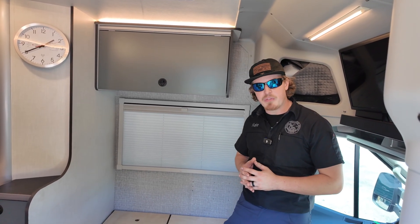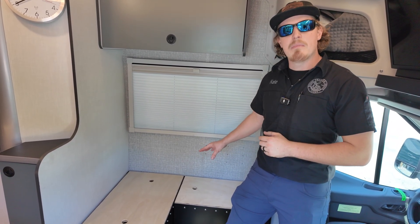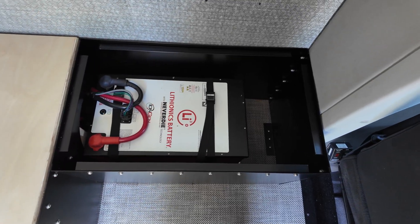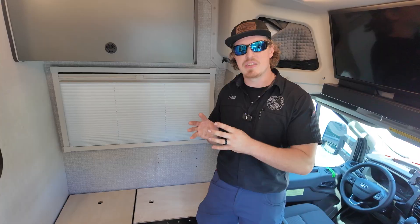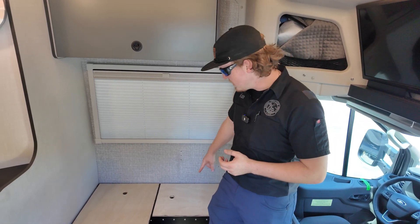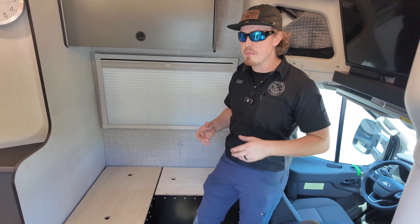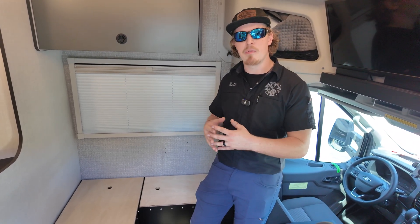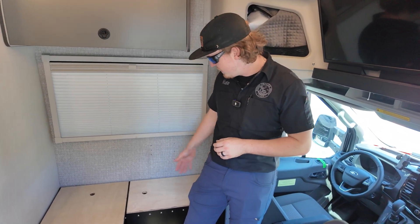In this particular case, the customer opted for a second 320 battery out front and a third battery installed on the inside — a lithium 630 amp hour battery — giving a total system capacity of around 1,200 amp hours. This is the more cost-effective solution; you're getting just about the same amount of capacity for a cheaper price. Running the single 630 is compatible even though we're running two 320s on the outside, and it has a slightly smaller profile than two 320s side by side, so they'll actually end up with a little more storage space on the inside in the front portion.